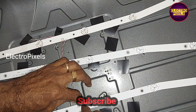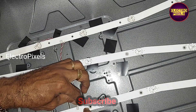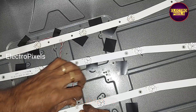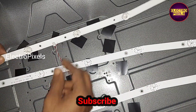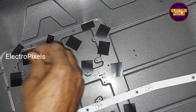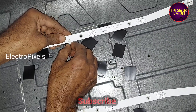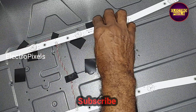This is a 6-volt LED strip — each individual LED is of 6 volts. While repairing LED backlights, we should always try to replace the entire LED strip with a new one, to avoid repetition of backlight-related complaints in the future.